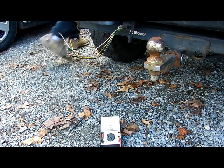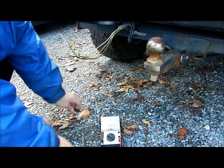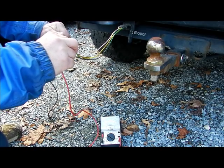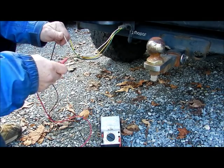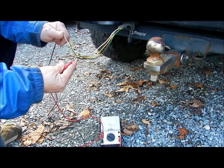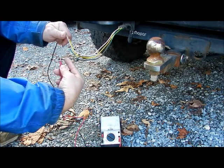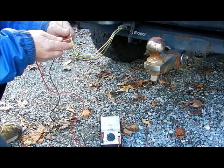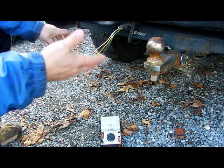Now I'm going to make a right turn. We're going to go to the green wire. We're holding the ground lead and not touching the positive side. We've got a pulsating signal on the green. Over here we have a steady signal — steady headlights. The headlights should be steady on both sides, and the right turn signal should not be running when we're on the left. This verifies that the vehicle side of the power is good.